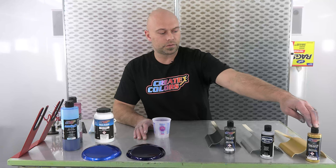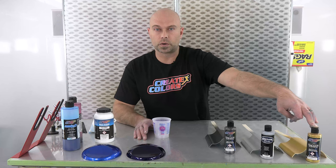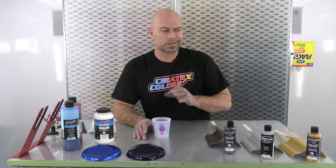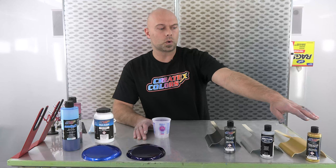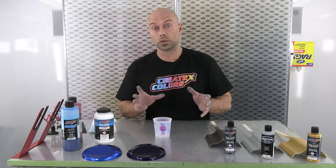The silver sealer is really bright silver, nice and clean, with a nice glitter effect — it looks really well with any of the candies. For the metallic gold, for the brightest effect you should go over a lighter sealer or lighter base color. I went over sealer white here. The metallic gold covers extremely well over white. That's a very clean gold, and it's going to give you that true candy apple effect. In the industry, the true sense of a candy apple is over a gold base coat.